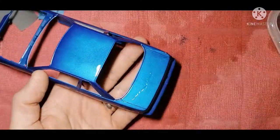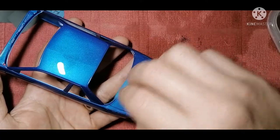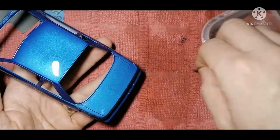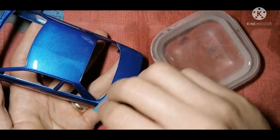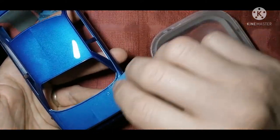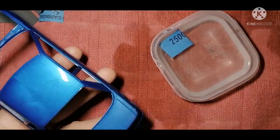You can see from the back where it's unsanded versus the polished area — it's night and day. In the end I went through about five applications on the roof. I always tend to do the wet sand and polish the roof first because then I know how to gauge the number of applications for the rest of the bodywork — the boot lid, sides, bumpers. Once you've worked on the roof, the rest kind of falls into place.